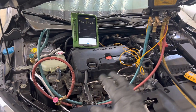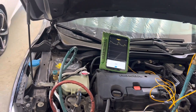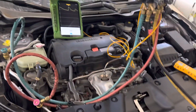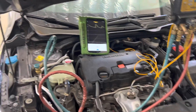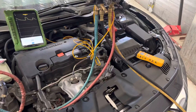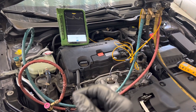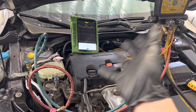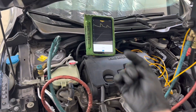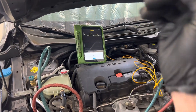If you burn up a compressor on a Y model and you have the rear system with the solenoid valve, and you have to cool the packs and the glycol loop system — all those lines have to be taken apart and flushed out. The accumulator is gone, the receiver dryer is gone, the condenser is gone. You're talking several thousand dollars of damage when somebody does it wrong. You better be able to prove you did it right to your customer, and if the shop cannot prove to you they've done everything and recorded everything, go somewhere else.